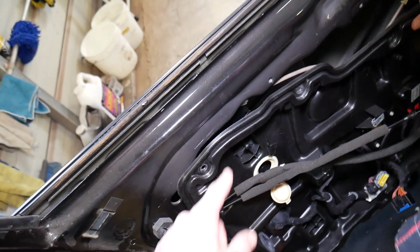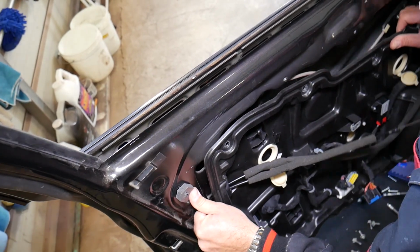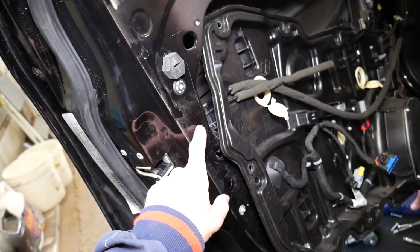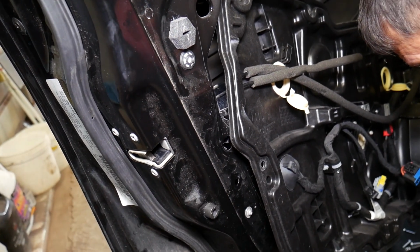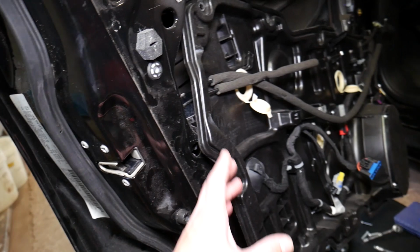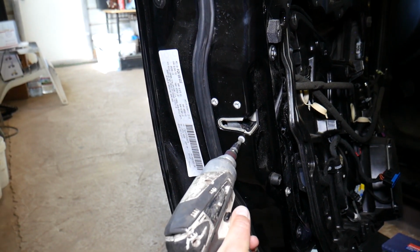So, the second part of the regulator is right there, still holding. Okay, we have a clip here. We have some kind of clip, guys. So it looks like we broke something here. That's why it's a good thing to always watch the video before you actually do it, because I think it will come with the door lock actuator at the same time, both of them. Not just the window regulator and the cover, but the door lock actuator. So we'll see that in a second.